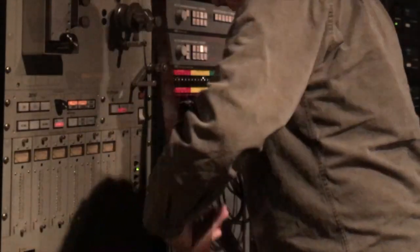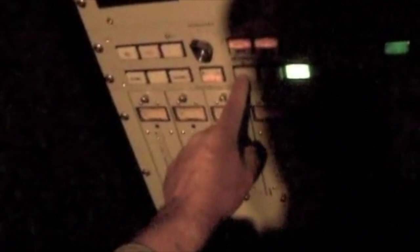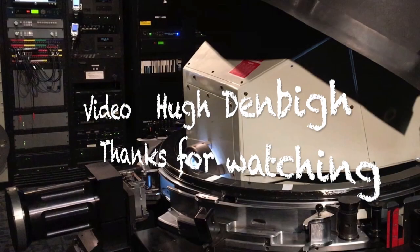This is called a dubber unit. It was originally designed for sound studios or recording sounds in a studio of some sort, but it was adapted for playback only by changing virtually the head on this thing. I'm looking at the start mark on this playback 35-millimetre magnetic film — there's no picture on this film, just sound. I'm going to manually cue it — there's the start mark. I'm going to push the clutch in, move it around, look back and forth, get that right over the playhead start mark. Zero the counter, take the tension off the motor, and then it can sit there and wait. I'll go back and check my feature film — all is good. Thanks for watching.